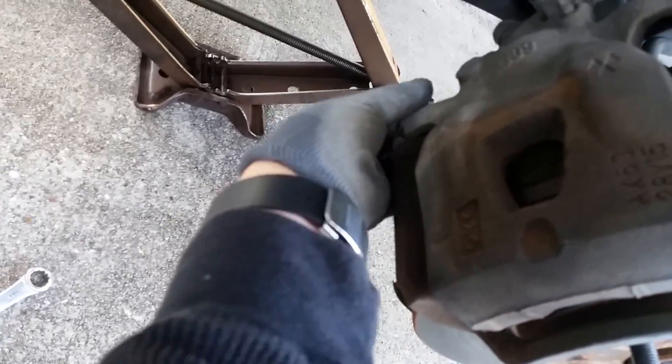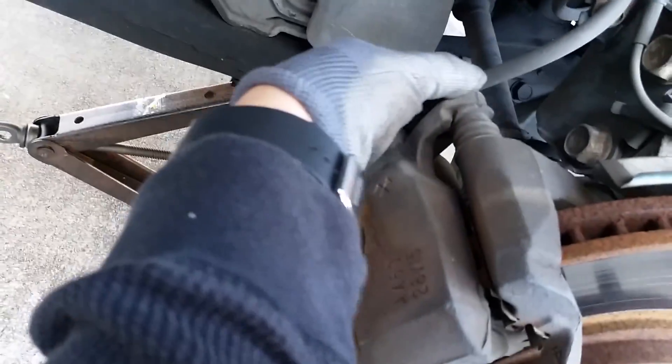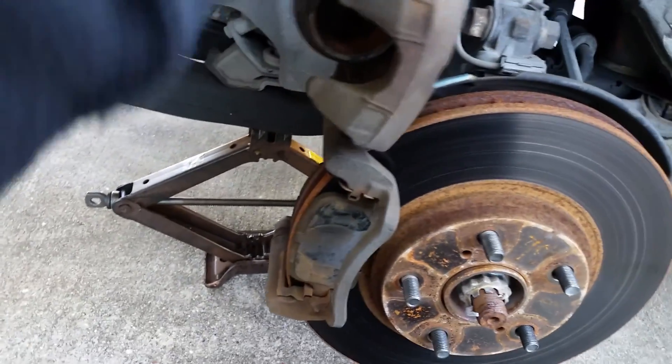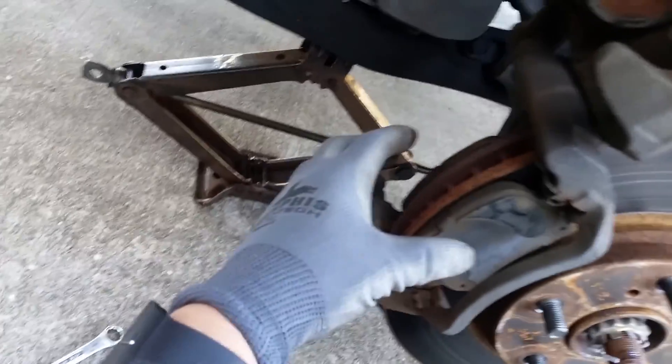The number 14 bolt was a little hard to get off but I'm undoing them — taking the last one, the bottom one. The top one is bit loose; that will allow me to hinge out this part, which is happening — see it right there. It just folds back, and this is the cylinder we're going to push back once we put the new pad in.